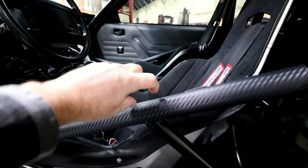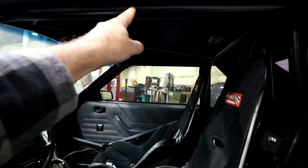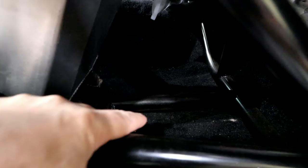It's got a lot of the funny car stuff — the driver's cage — it's got this kicker bar which is mandatory. If I wanted to make the funny car portion, I would just add that tube and go up, tie in here, cross, back down, and tie back in there. Everything else is ready. It even has the tubes that run through the floorboard under the driver's seat — you don't see them because I've got them recessed into the floor, but they're there.